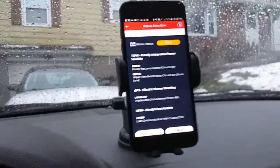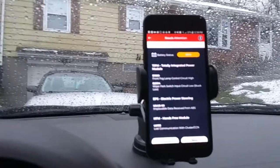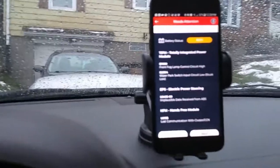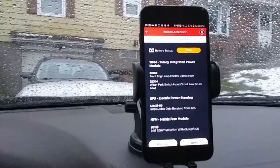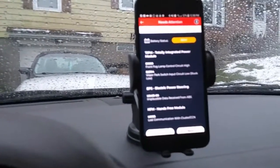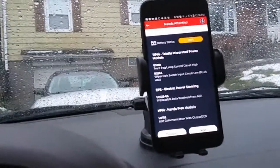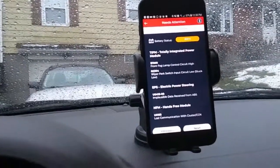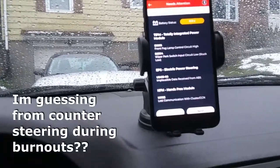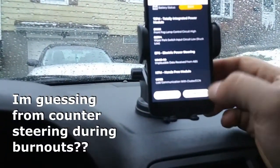Battery status 12.11 volts. I do have a B1660, which is my front fog lamp control circuit high — that's because when I bought this car I had aftermarket LED Chinese bulbs with no part numbers on them, so one of the bulbs is bad and I can't even replace it. Wiper park switch input circuit low — that's new. EPS electric power steering implausible data received from ABS. Hands-free module — that's because of the radio with my headset and my phone.